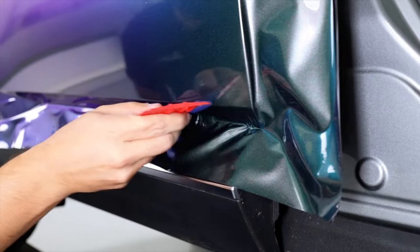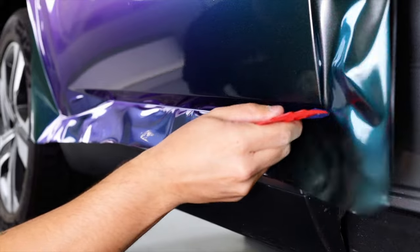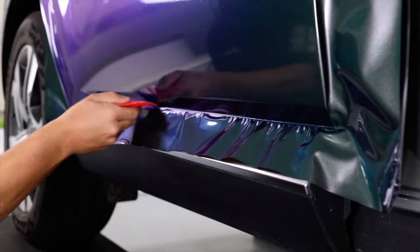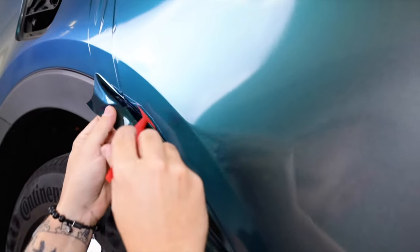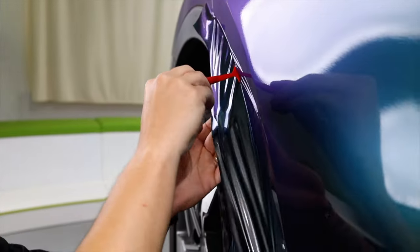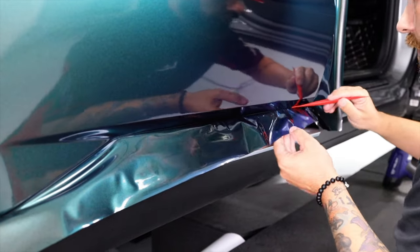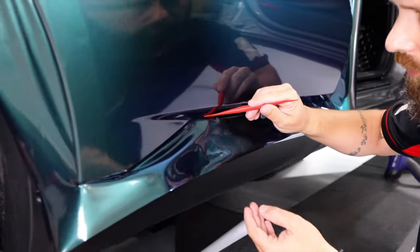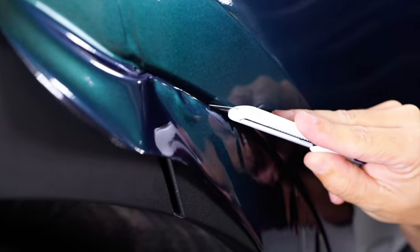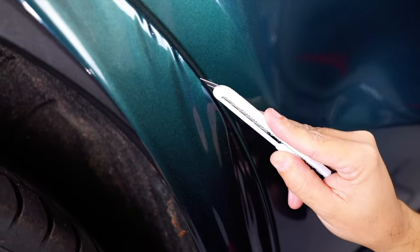At the outside edge, pick the material up and tuck it stress-free to the outside edge. Once the material is tucked in evenly on all sides, pick it up and make sure it's fully sealed in any tight gaps. There's rubber molding on the side and on the bottom, so the material is picked up and using a tucking tool — again from our vinyl — tucked tight into the gap and then cut safely away with a knife.